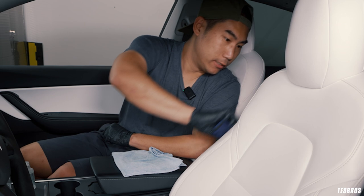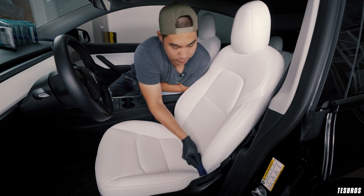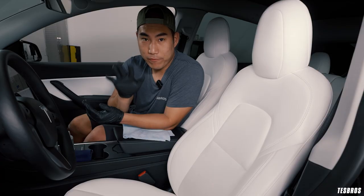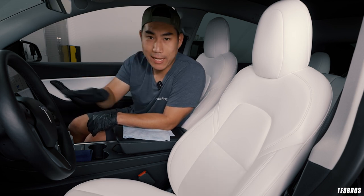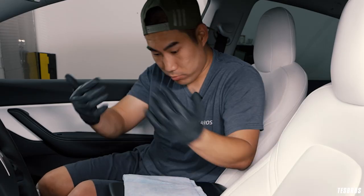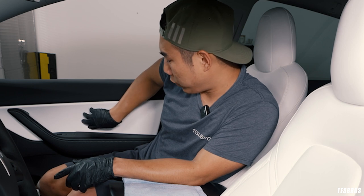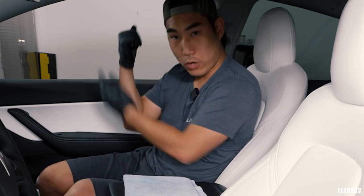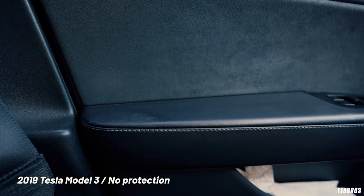A little bit less product for the back. In a few minutes I got this coated. I'll wait 15 to 20 minutes and let it sit. Then we're going to get a clean microfiber and wipe it down to level it — that's when we remove high spots. While we're waiting, you can move on to the next seat, the back seat. The vegan leather is here as well, and this armrest is a very heavy-use area because a lot of times people put their hands there — with lotion, oil, and other things — leaving residue and oil right there.